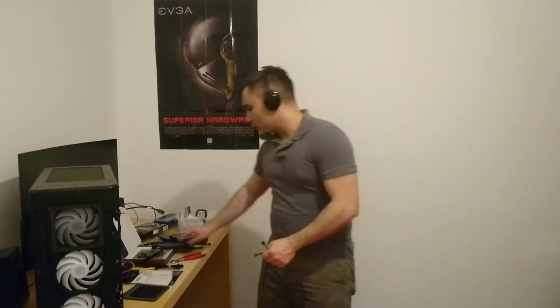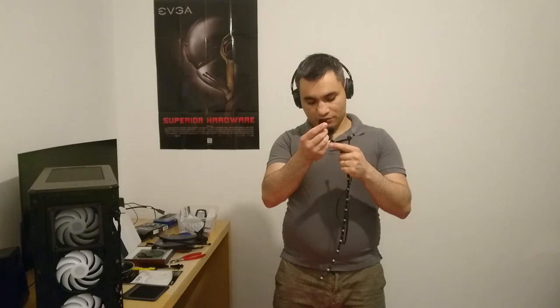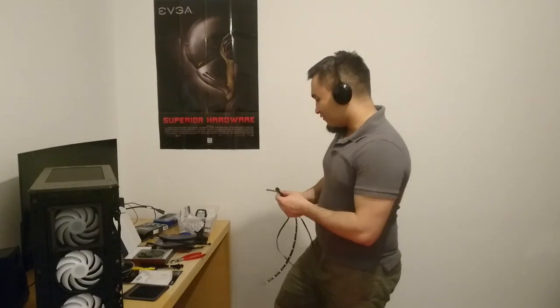Okay, Juzo here, I'm back. I've just been through an ordeal. Okay, it was not very hard, but it was tedious. You see, I got this RGB strip for my new build, but it came with one of these Molex, I think it's called a Molex extension. So you are meant to connect the RGB strip to this and then somehow to the power supply. Won't be using that. So I had to go dig out my old case that I put back into its box and get that has an RGB strip that was connected to the motherboard onto an RGB header, just what I need. So I just got that, and I'm gonna have to order another one later on, but for now problem solved. I'm so excited.